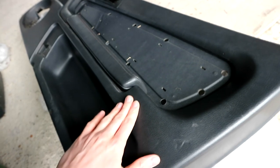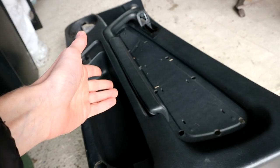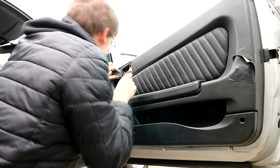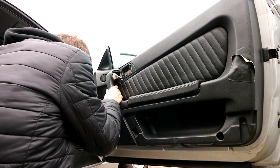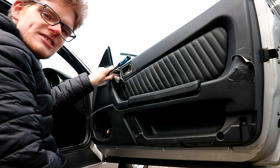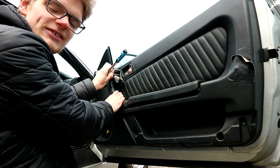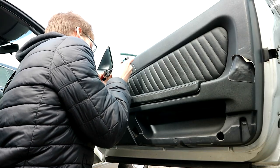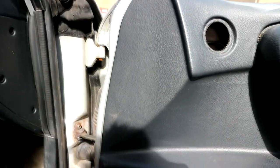There is a little mark where the seatbelt buckle on the car these came off was threatening to do the same thing that's been done to my car. They are far, far better - and crucially, neither of them have got a bloody hole in them. We'll start with the driver's one. Removing the door card is relatively straightforward, as parts like window switches and the door pocket come off with ease. The speaker grille is popped off before the speaker itself unbolts, after which I begin unbolting the main body of the door card. One bolt behind the electric window switch, however, is a different size to all of the other bolts on the door. Thanks, Alfa!